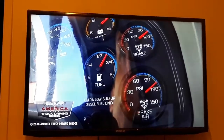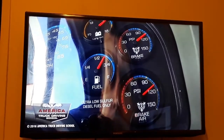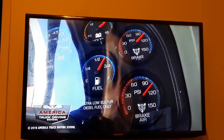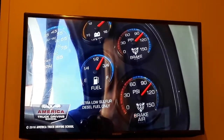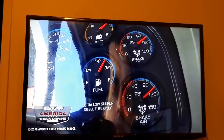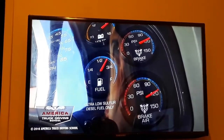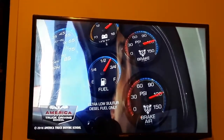We're going to press the pedal, get it close to 100 PSI, and wait 15 seconds for the PSI to rise. The primary is at 104 and the secondary is also at 104. The gauges have begun to rise in both the primary and the secondary, meaning the gauges began to rise at 104 PSI in both, which is not lower than 100 PSI, so that is a good test.